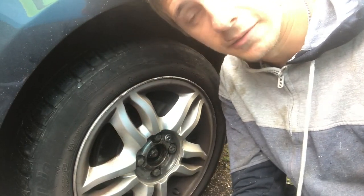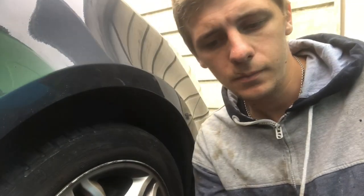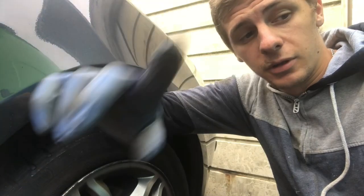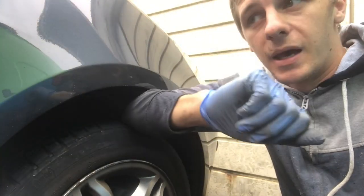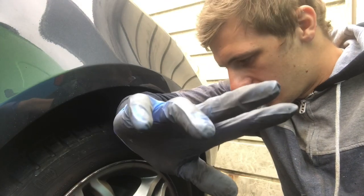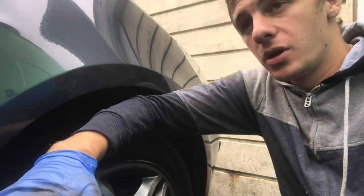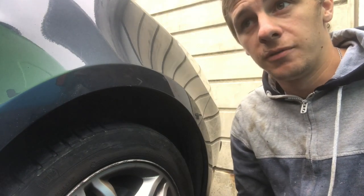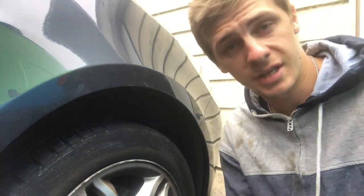The other side of the car seemed okay — there's nothing I can find that looks like it could fail anything. I'm going to do some bonnet checks now. Windscreen washer fluid is in there — checked it, just a quick squirt, it's all fine. You want to check brake fluid, power steering fluid if it's there. You want to check for any oil leaks because you may get an advisory on that. They will do a brake test on a rolling road to make sure your brakes are efficient — I can't do that, I haven't got a brake tester — but driving the car it's not pulling to one side and the handbrake works fine. They will do an emissions test as well, and there's no dashboard warning light showing for emissions.